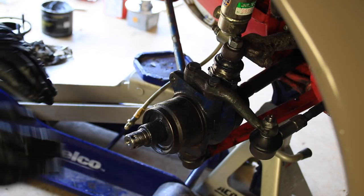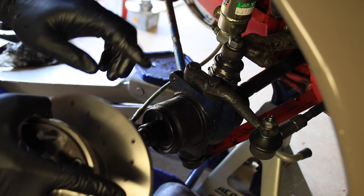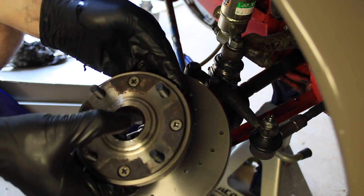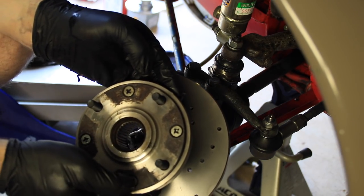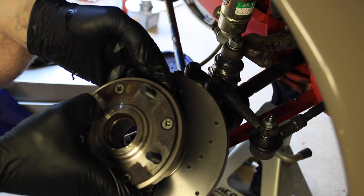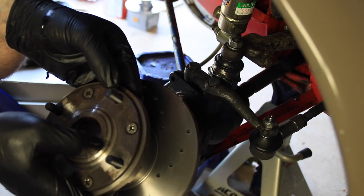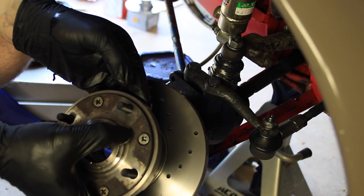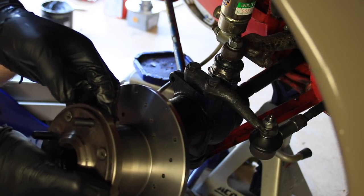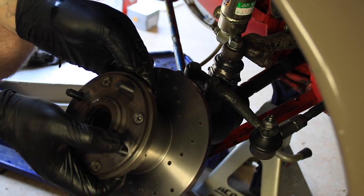The next thing we're going to do is actually put our new discs on. These new discs are drilled out, so you've got little holes all along your disc. Now we're going to reuse the old drive flange — that's this piece right here — and it's held on with four screws that come out pretty easy by hand. You'll take this drive flange off of your old disc and apply it to your new disc. Now if you're getting a whole new disc brake setup and you've had drums in the front, this will be a little bit different. You're not going to have this drive flange, and your new disc assembly should come with them. If it doesn't, you're going to have to buy a drive flange separately, and I'll put links down in the description for that.